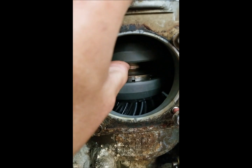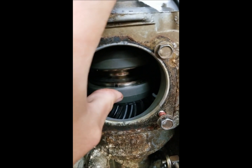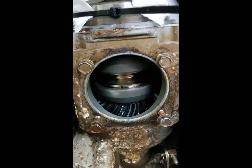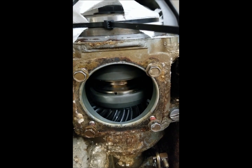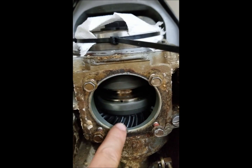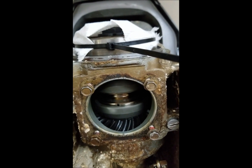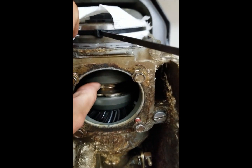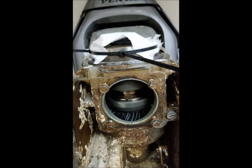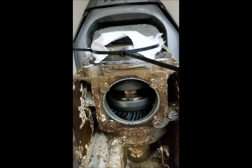What I'm guessing is that the cone clutch is glazed, and probably the surface of the gear as well. I've been digging on the internet extensively and in the manuals. I'm going to try to break that glaze and replace the clutch. The problem is these gears are shimmed exactly for the correct lash and the correct mating pattern with the gear teeth, so theoretically if I put all the shims back in the exact same spot we should be good.